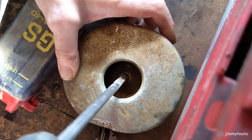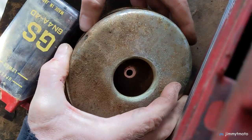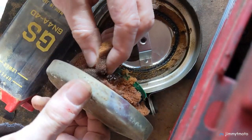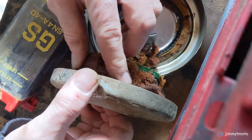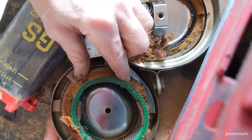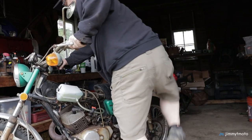A big thing before trying to start one of these old bikes for the first time: I always inspect the air cleaner. What I found was pretty typical — the foam air filter was badly crumbling from age. Trying to start the bike in this condition would just suck all of that crumbling foam into the carburetor and cylinder, so I'm glad I checked first. We'll just leave the air cleaner off for the initial startup.